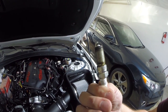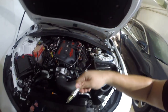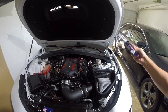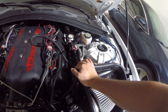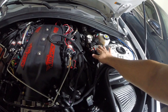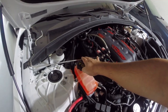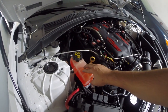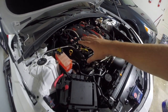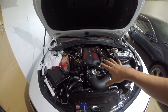Here's cylinder number one at the very front - it's pretty clean, no oil, just a little bit of anti-seize. These were NGK LTR6s, and our new ones are LTR7s, which is one step colder, so we can run all the way up to a 150 shot. With the nitrous install on this side, we should still have enough spacing to remove the plugs. On the other side we'll loosen the tank, disconnect the back line, and lift it out of the way - similar to when we did the headers - to give us plenty of room to reach the front spark plug.